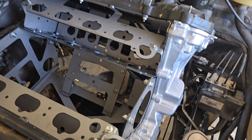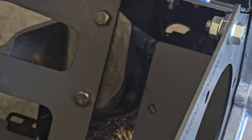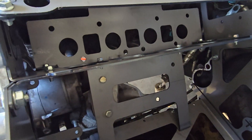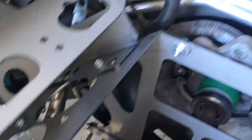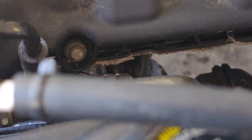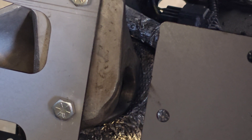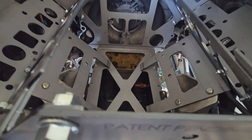I don't always get lucky, but the gods must be smiling. The LS9 motor mount on the body on a Coyote block kind of sort of fits! So literally mimic the LS9 motor mount, incorporate the Coyote bolt pattern on both sides, make the holes slightly more slotted or bigger for clearance — and look at that, it's lining up. We have an LS9 motor mount bolted to a Coyote on the body mount. The bolt's a little crooked but generally it seems like it's going to work.